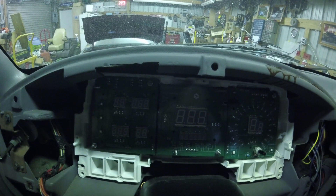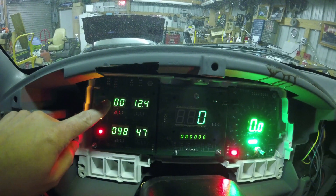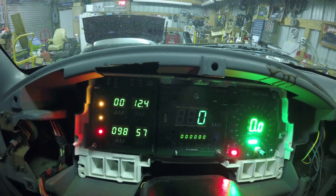We've got the updates done to the fuel gauge, everything's back in the truck. We have a brand new fuel pump assembly and fuel level sender assembly in the fuel tank, and a new wire run from the fuel level sender up to the instrument cluster. Just to refresh everybody's memory: that's oil pressure, battery voltage, water temperature, and this is a fuel percentage.